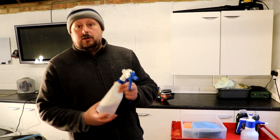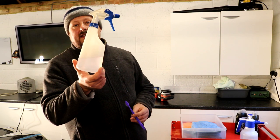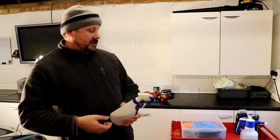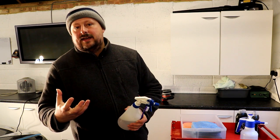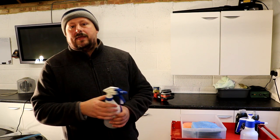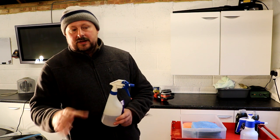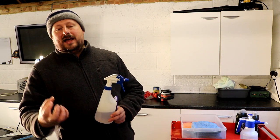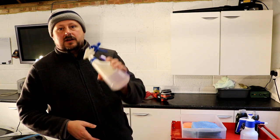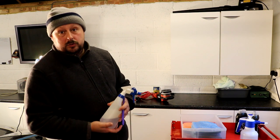The only other thing to mention, I've got just standard APC, diluted right down, and a toothbrush. When I finish with a particular pad, it's getting caked up, I've already cleaned it a few times and I want to move over to a fresh one, I'll rip that off and I'll just squirt it with APC just to stop the pad drying out and all the polish powdering up inside the pad, and that just makes it easier to clean later on. So always have that to hand when you're polishing. Alternatively, a bucket of clean water will do just as good a job.